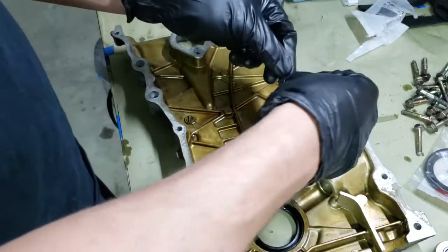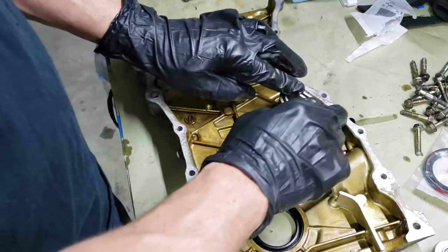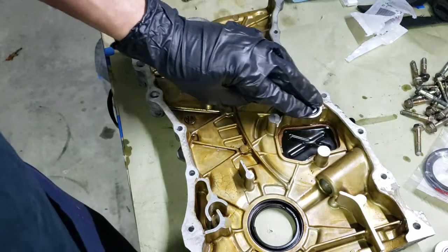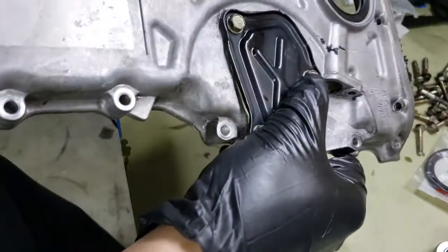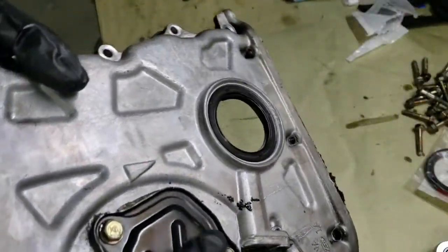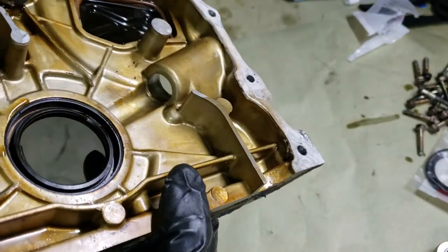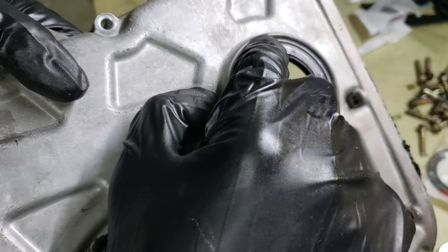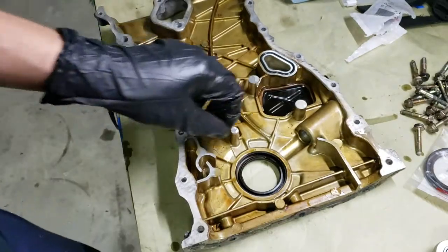Just replace it and make sure you orient it correctly. It's that simple — this is nice and round and definitely going to seal up easier. We're going to change our crank seal. One thing to note is to try to note the depth of how far it's inserted, because you can over-insert these. The outside edge is pretty well flush with the inside edge of the aluminum lip.